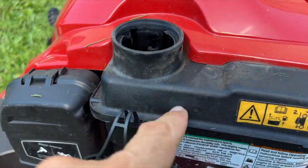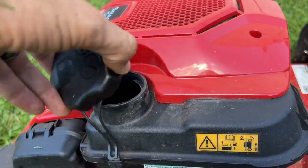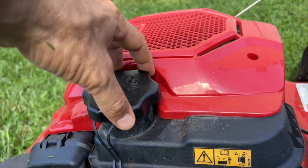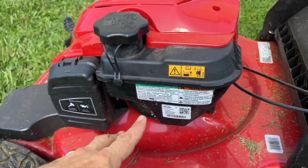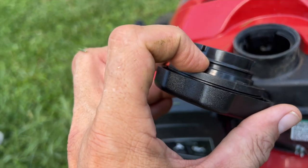Sorry for the AC in the background. You can see some dried up gas residue here — we just spilled a bunch of gas on here. Like I said, I took the gas cap, it popped off, threw it back on — I'm doing this one-handed — and look, you can already see this isn't snug. When you start this motor up, that's going to wiggle right off. What I realized is there's a gasket that goes in here that somehow came off.